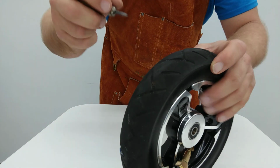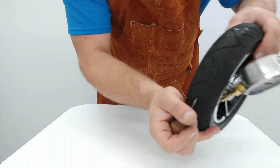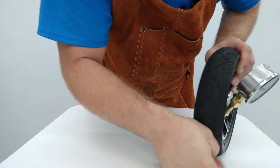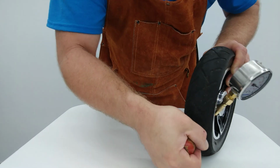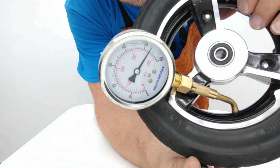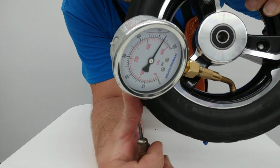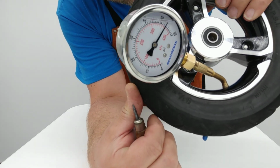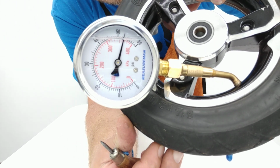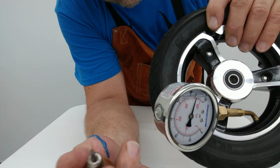So we're going to do a little testing, and we're going to take this guy. This is that same hole that caused a flat earlier. See a flat there. We're going to cause a new one right here. All right, so pretty sharp little pointy object, and there's our pressure gauge. So you'll see we haven't lost any pressure, but let's see what happens when we pull it out. Hey, we still didn't lose any pressure. So lost a little sealant, okay? But you'll see instant sealing and without any pressure loss. This is representative of about a 16-penny nail, so it's a pretty good sized little tool.